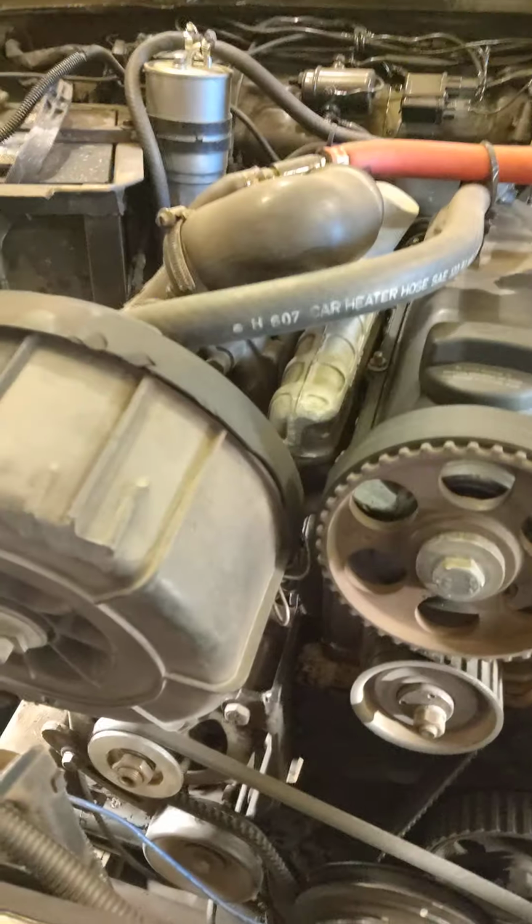I was on some off-roading page about dune buggies or something, and they mentioned a Honda B pump being driven off the crank. With the limited space I have on the front of my motor, because they stick an injection pump on this side and an alternator on this side with the turbo, you start running out of options on where to mount a power steering pump. There's not a lot of places. So when I saw on the off-road page this guy with his desert race dune buggy, he had power steering and he was running a Honda B pump, I figured that was a perfect alternative to having Armstrong steering. So that's the way I went. It's worked very, very well for about 3 years now.